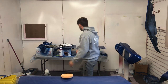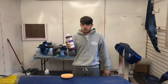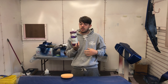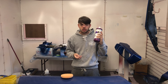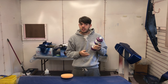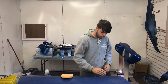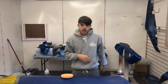For the compound, we've always used 3M's number one — it's our cutting compound, and that's what we've used since the beginning. You can get it at Pep Boys in the little bottle, but we always buy it on Amazon. It's about $30 for a tub, and 9 times out of 10 this tub can do two vehicles — unless it's a really big vehicle or you need a lot of buffing, and it might only last for one. But it's worth its weight. I'm going to get set up and show y'all. I'm going to do one section so you can see how it transforms from this ugly dullness to a shiny mirror.